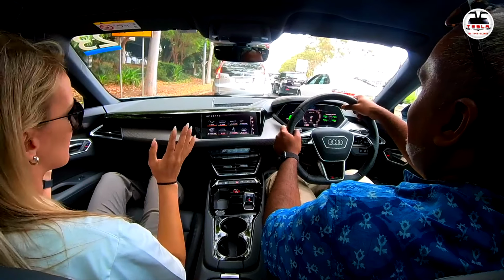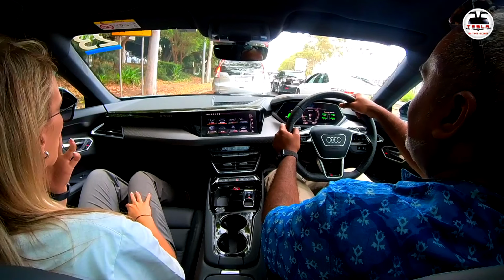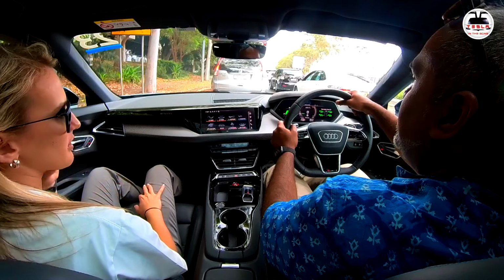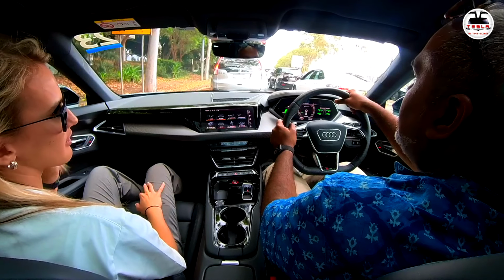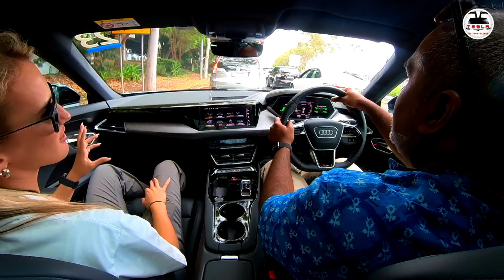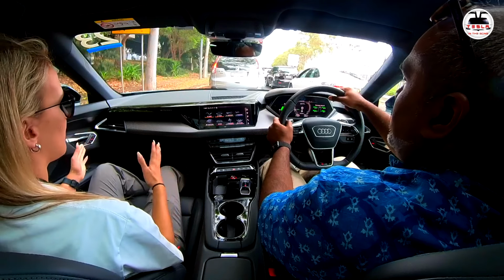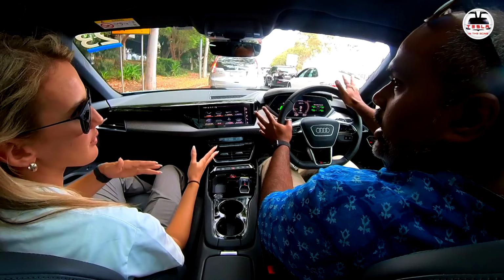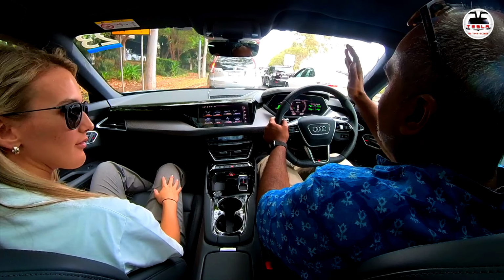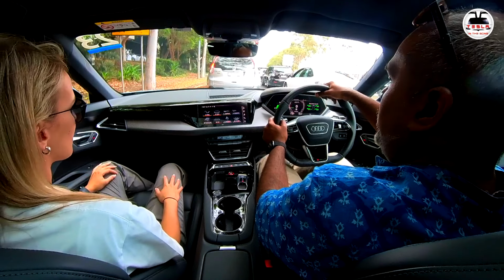They say on paper it's 13 hours. Trickle charge, that's what it is. Yeah. And then there are 11 kilowatt wall chargers and also 22 kilowatt chargers. So 11 kilowatt is, they say, about 8 to 9 hours. And 22, they say, let's call it 3 to 4 hours, depending. True. They're just giving that range from 5% to 80%. And you guys sell all those three chargers as well, isn't it? So you can go from 7 to 11 to a 22 kilowatt charger.